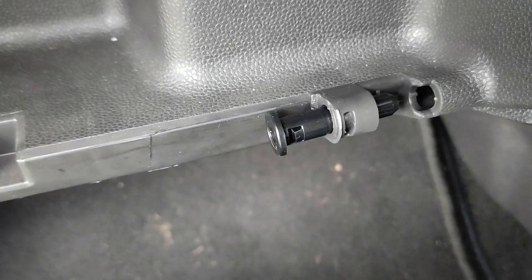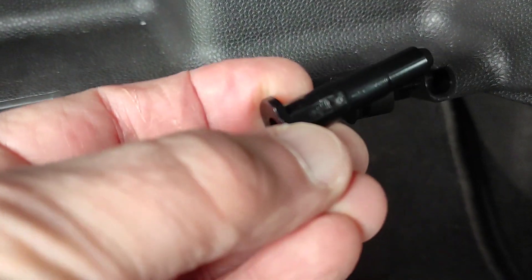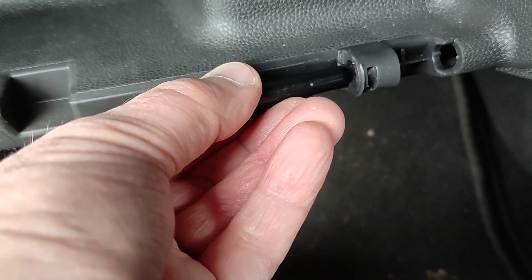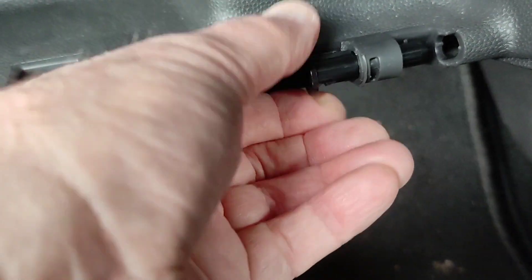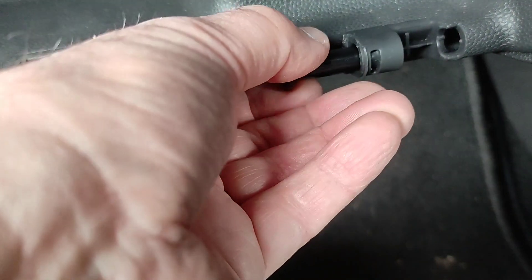When it comes to putting it back, they don't make things easy — these pins are keyed on the back. You can see there's a little bit that sticks out, so they're rotationally keyed and can only go in when in one rotation. It goes in like that, but if I rotate it round, it won't go in. So the pin needs to go in that specific position.